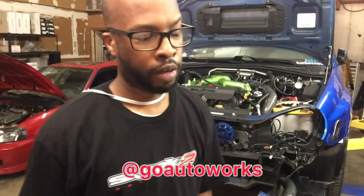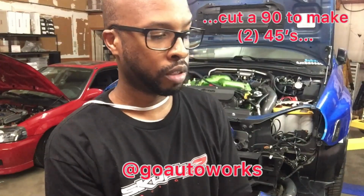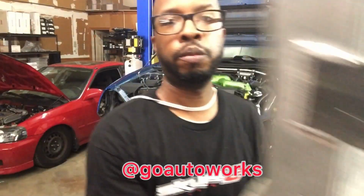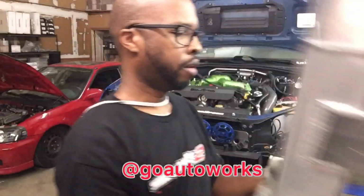I've got the intercooler all modified. You saw I put the 45 tight radius aluminum 90s on the tanks, and also went ahead and added the top M8 weld bung, so that'll support the top, and I'll get it mounted back on.